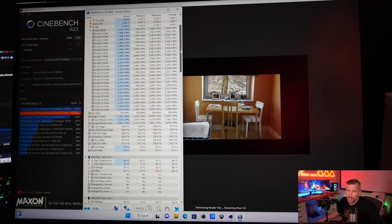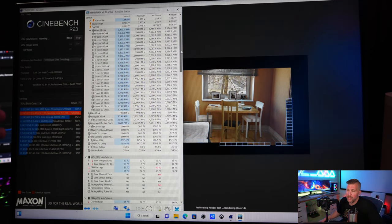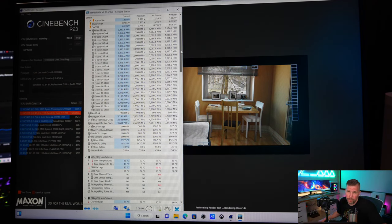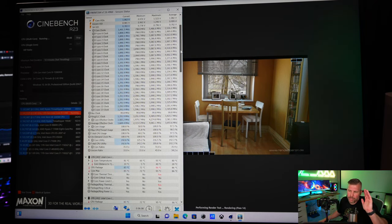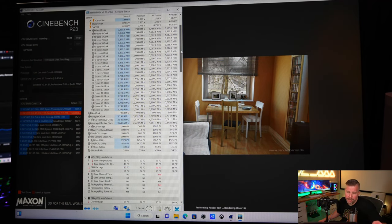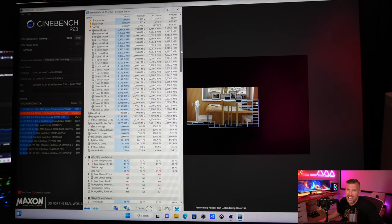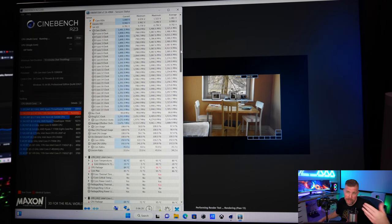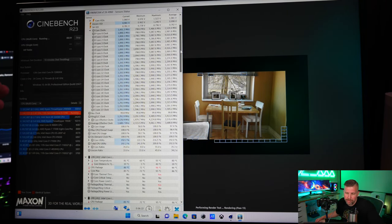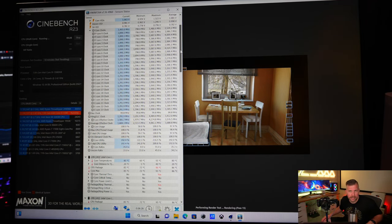It's very rare, though, that you're going to crash from an undervolt that's too severe, unless it's just like a crazy minus 1,000 millivolt undervolt or something, and then it's just impossible for the CPU to even work. But usually there's limits placed on it. Usually minus 150 millivolt undervolt is about the max I've ever seen a laptop be able to do. But I don't know, this new generation, maybe you can do a minus 125 millivolt undervolt on most of the CPUs. We don't know. I hope that makes sense.